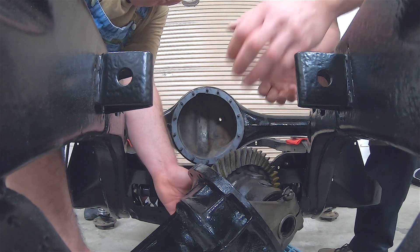So for this bump stop right here, when we have the suspension all the way to the top, put a little bit of oil soap on there to help with the rubber part and get it in there. Here we have the axle bump stop. This metal part — you'll have to pull off the old one that you're replacing and apply it to the new rubber bumper. It simply mounts on the bracket with a single nut and lock washer.